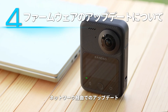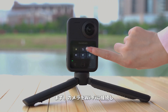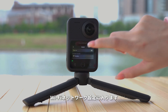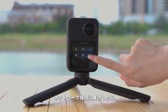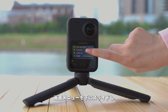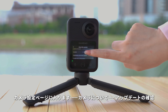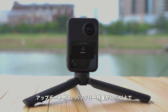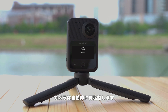Firmware update. Download the latest firmware via Wi-Fi. First, connect the camera to Wi-Fi, scroll down the screen menu, and long press the Wi-Fi icon to enter the Wi-Fi network settings. After connecting to the internet successfully, slide down the screen menu to access the camera settings page. Enter About Camera, then check for updates and follow the instructions to update your camera's firmware. Please ensure a stable and uninterrupted network connection during the upgrade process. When the upgrade is complete, the camera will automatically restart.